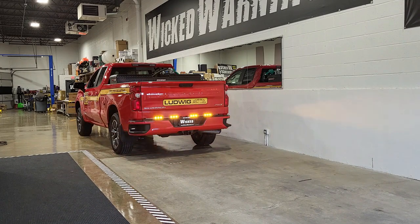Sierras have the same bumper, so feel free to do that on a Sierra if you have one as well. Keep in mind the Thin-X strip underneath the Silverado bumper is very tight — there's not a lot of room and it's kind of tricky to get it mounted. Fair warning, it's not that easy, but definitely doable. Take your time, have a buddy stand behind you to make sure you're not inadvertently putting it on there crooked. Use our primer promoter and make sure it's stuck very well.